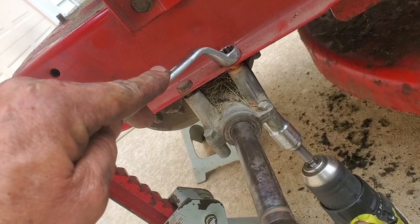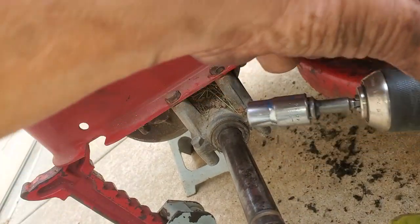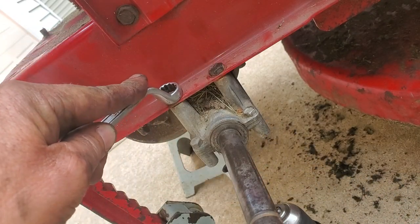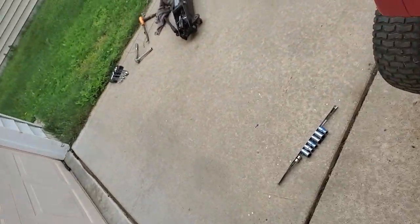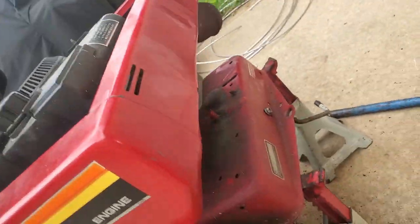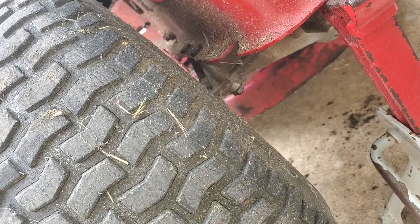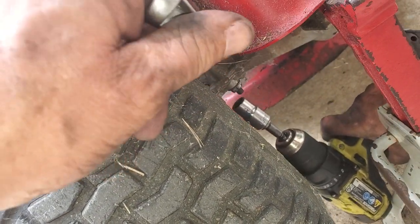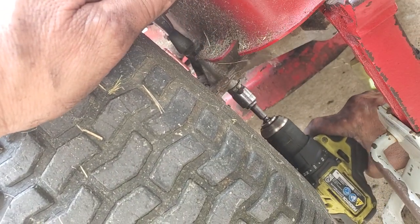We're going to bring this transmission back up to the frame. Kind of like using this clutch drill over my impact — I messed up and got a bit dropped off in it. Here we go, it didn't just drop off, it broke off. So hold these bolt heads right here, get these back on real quick. I kind of like the drill because it's got this clutch on it so you don't strip things or over-torque them accidentally — it's kind of neat.